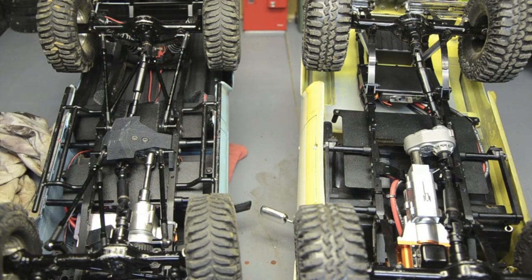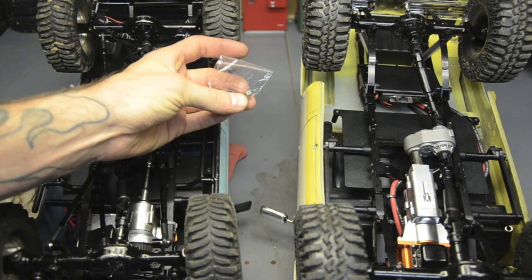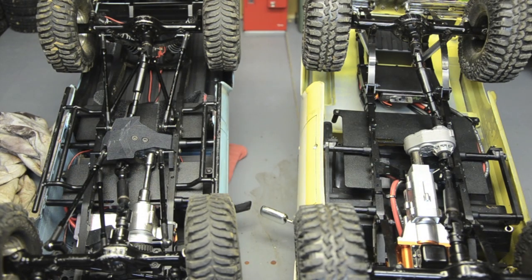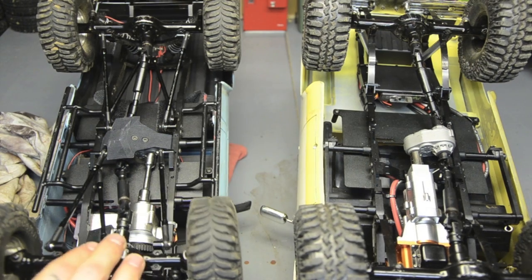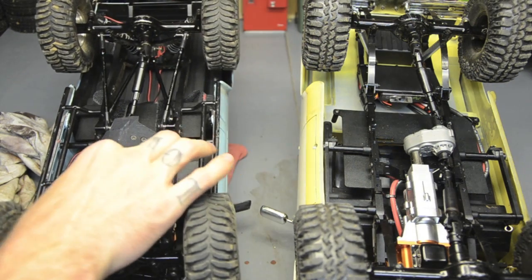They're just a pin set through. I'm not sure if those would even come apart. And if they would, you probably couldn't get them back together. So these have a scale bolt. The little baggie of stuff comes with a scale bolt tip, so you can remove it and rebuild them. And that, other than being slightly larger diameter, is probably why they are a little more expensive. Looks like no issues here on the front